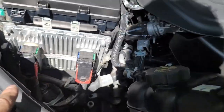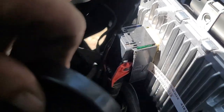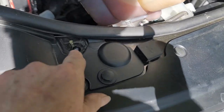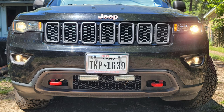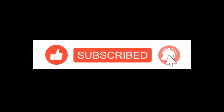I got it in. I put one arm up through that hole and used my finger to push on the light, then used my other hand to twist it clockwise to lock it in place. I'm putting the rubber cap back on — probably can do it from up here — and then I'll put this back in place. The lights are done and it's all back in place.